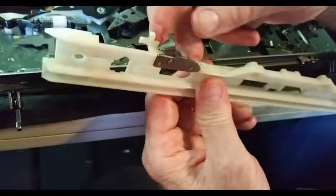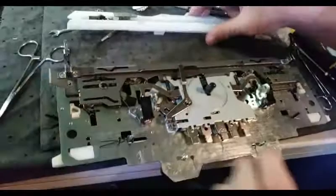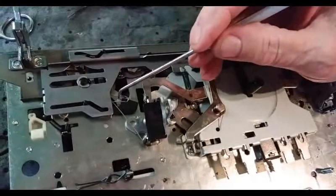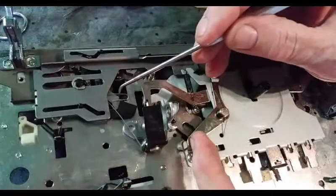You've got these, one on either side, that must be fed down into this slot. Multiple things have to happen at once. That piece, when it comes through the carriage, it goes under this spring — this spring actually straddles it, and that's what holds it into position. On this side you can see it and you must unhook it. It goes under that black piece, not over the top. It'll want to ride up, it can get over the top, but it should not. On this side you can at least see it, and I'm telling you to take it off before you remove the foot.